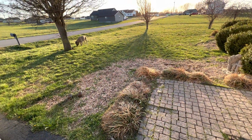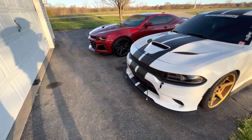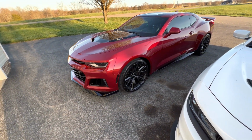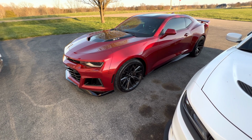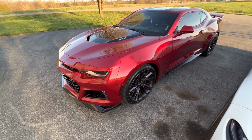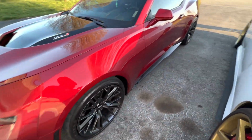The motor has been gone through. It's got stock pistons and rods, but it's been regapped, better bearings, valve springs, all that stuff done to it. It has a complete build sheet that it came with. And the crank's been pinned and all that stuff. So I mean, it runs pretty nice. I'd go ahead and do a crank up.